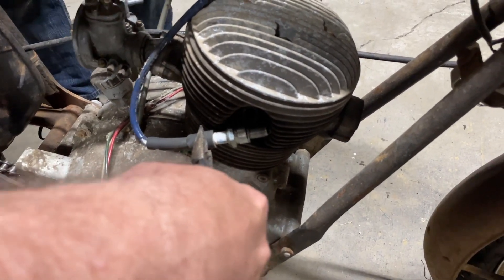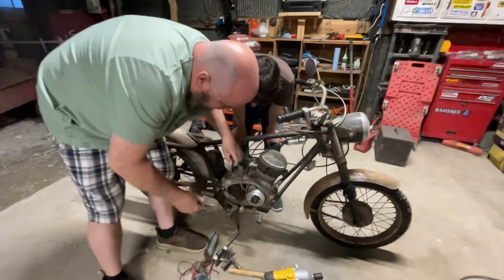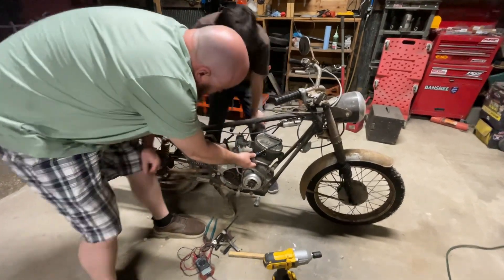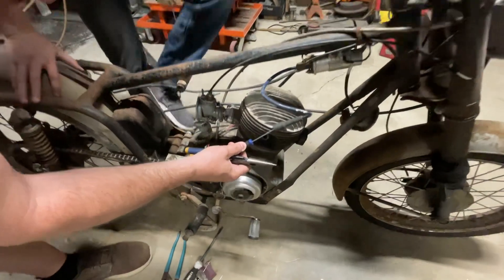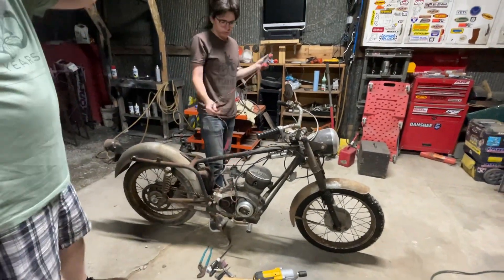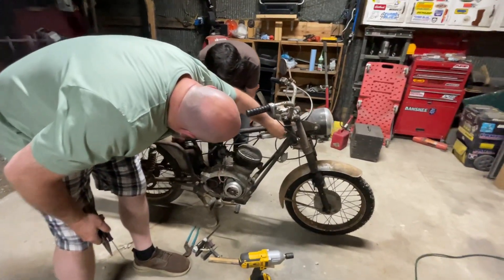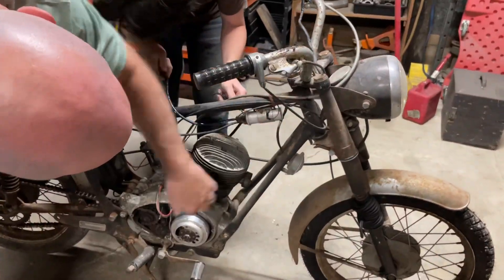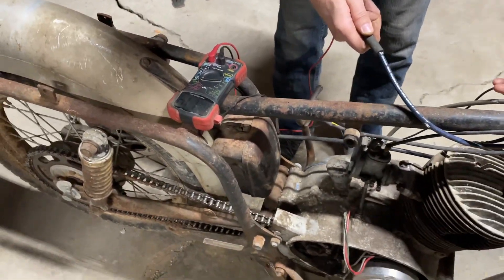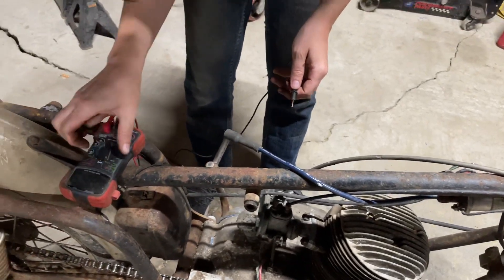No squirts. What is the deal? I wish we had a way to actually measure the spark itself — you know, it's actually open. Let's just be sure. But it's not bad, you know? It's like the coil is just shot. I'm gonna check this. 11 kilo-ohms. Yeah, it is shot, because it should be like 3 ohms, I think.